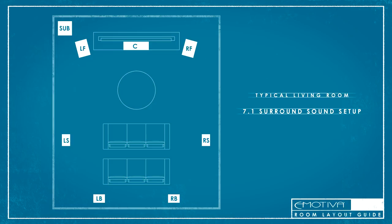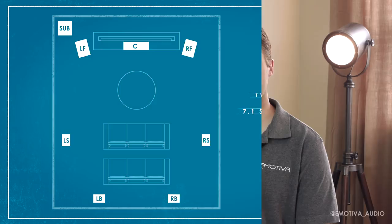The question then remains is whether or not you actually need a 7.1 channel system. If your room is on the larger side or you're trying to encompass multiple seating areas — let's say you have multiple rows of seating in your theater — a 7.1 channel setup is likely going to be best. However, if your room is on the smaller side and you only have a single row or maybe two or three primary seating positions, then likely you can get away with a 5.1 channel system.